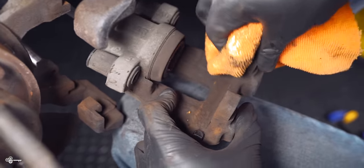So when looking at my brake wear sensor, you'll see that everything is still intact because the brake pads in the rear really weren't all that old. But if you look here, the plastic is still intact. So this is still a perfectly fine sensor. If you are gonna replace it, which I actually was planning on, but this is fine, so we'll just save that for another day. All you need to do is just follow the line. It just goes back here, around, and then it plugs in right under here. So to get to the little box that houses the connection, all you need to do is just pull off that 10 millimeter nut, and then you can just pull this up and then you can just retrace the line. But like I said, this is still fine.